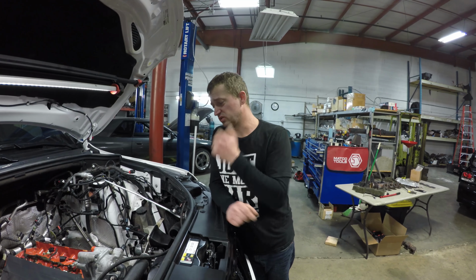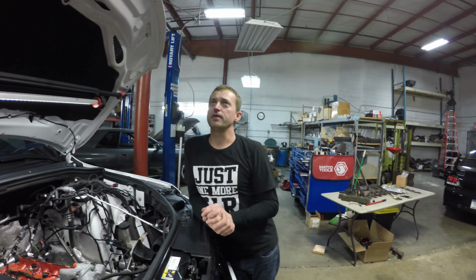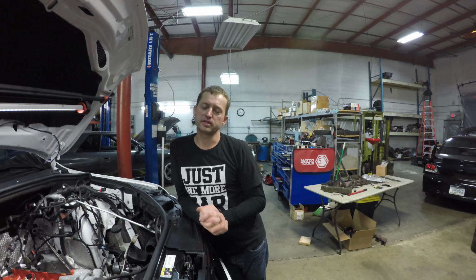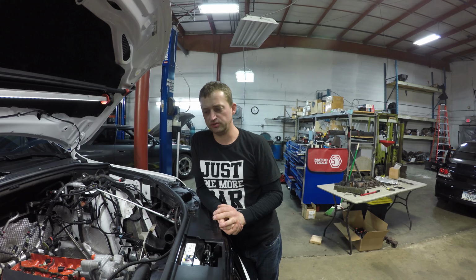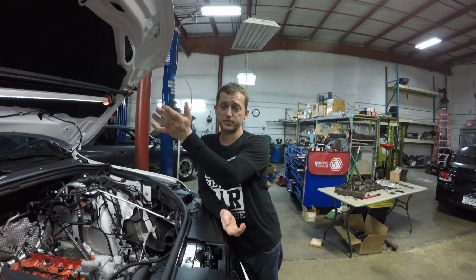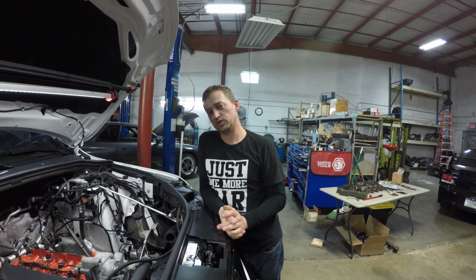I reckon it's going to lose about 30 to 35. No, more than that. We'll run it at 7 pounds to see. That's a good idea. We'll run the same boost pressure, just to see the difference, and we'll push it on 93. The timing advances are going to go quite a bit higher, but I reckon it's going to be about 20 to 30 horsepower difference.